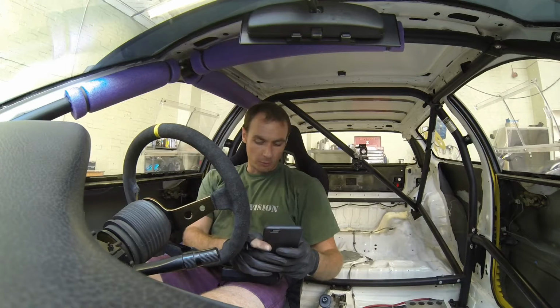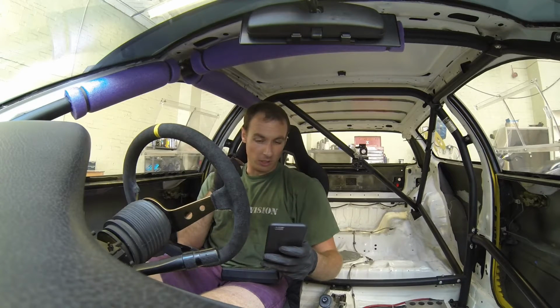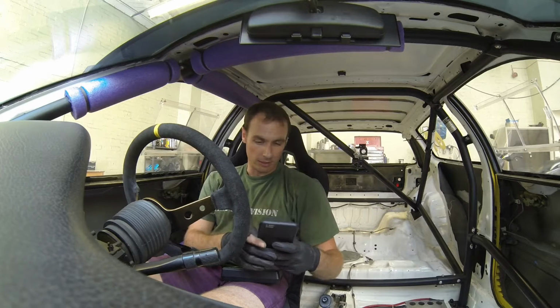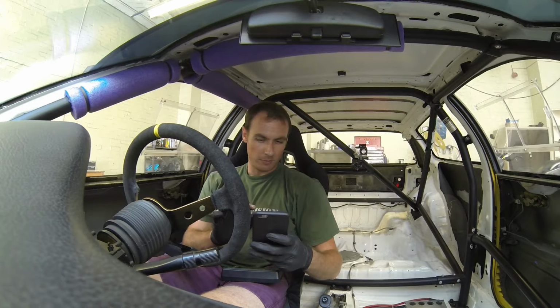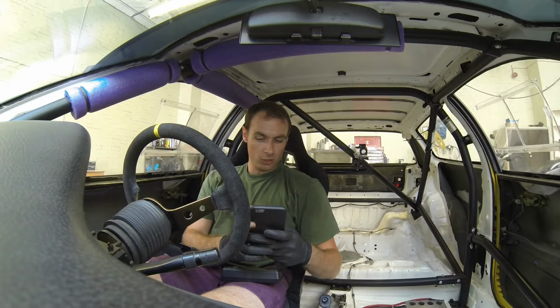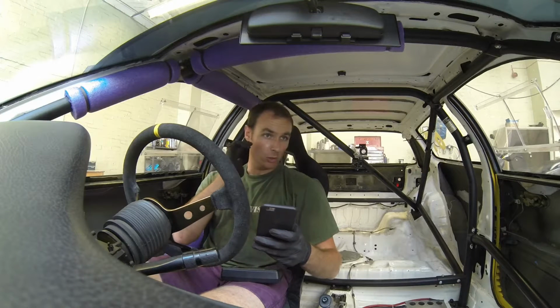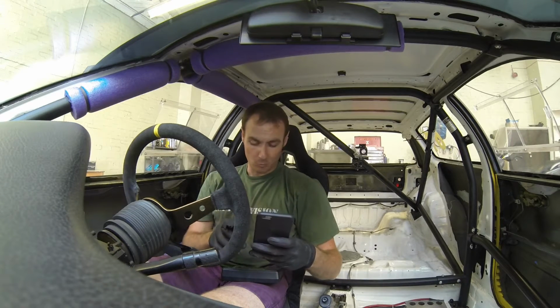So now we've gone from 30.7 to 30.3, even though we wanted to go up on that corner, but this corner's gone up to 19.2 from 18.5. So let's add them up, see where we're at. So we were at 48 on the nose, is that right? No, 37 plus 18.5. So 30.7 plus 18.5, which is the weight of these two corners, puts us at 49.2. So it's pretty close.